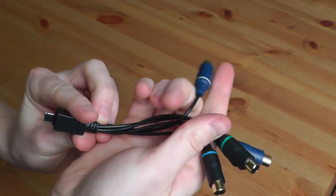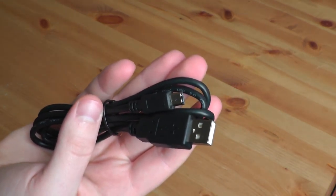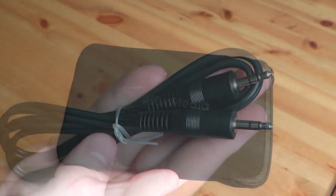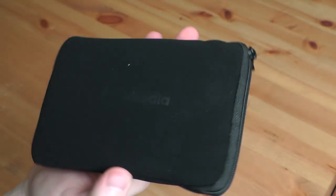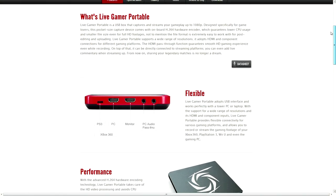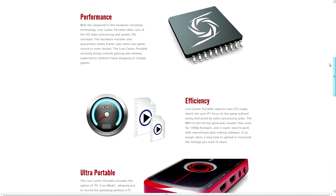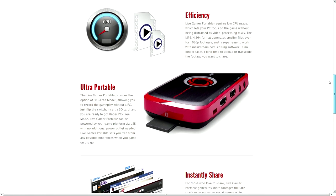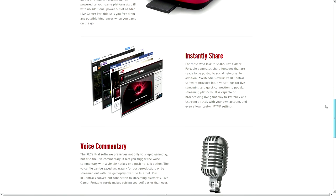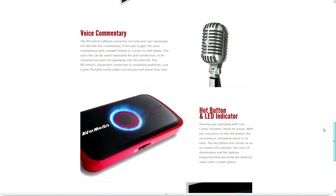The best way to set this device up is using HDMI cables. It does have component converters for it. Then you plug the thing into your computer with a USB cable to provide it power, and you can also record directly to the computer with that USB cable. You can put an SD card in there and record to the same computer you're gaming on, or to an entirely different computer you're using for editing. You can even stream with the card. A cool setup would be a desktop for gaming and a laptop next to it running your Live Gamer Portable — you could stream from that or record to your laptop.